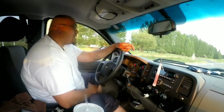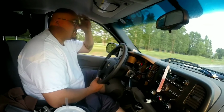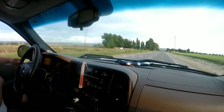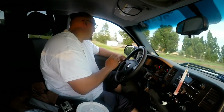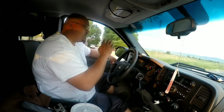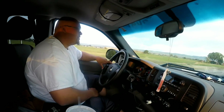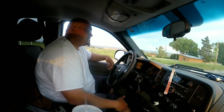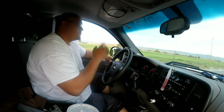I cleaned out the throttle body positioning sensor, cleaned out the throttle body, cleaned out the spark plugs, I fixed the exhaust leak, and on GM motors they have an issue where once you touch the throttle body, the PCM relearns everything, on certain trips and stuff like that, it'll just kind of relearn it every once in a while. It needs to relearn. And sometimes it takes a couple hundred miles to relearn if it doesn't work in the 3 minutes for the reprogram time.